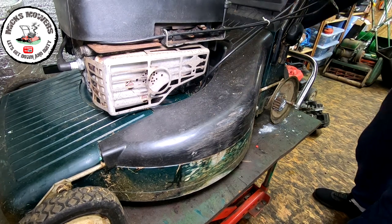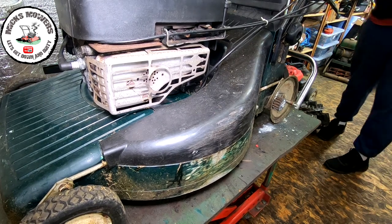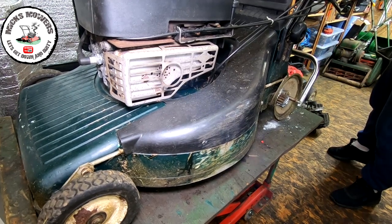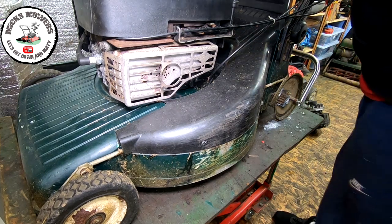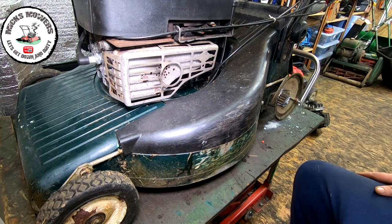Okay, so straight off the bat, that belt is not even moving at all in its position. I heard a little tiny squeal. You hear it? So therefore, the belt is not actually running at all. The belt's not turning around, which means the gearbox is not turning around. So it could just be a belt problem, right? Could be. As I say, the bloke didn't want me to invest in it and spend any time in it.